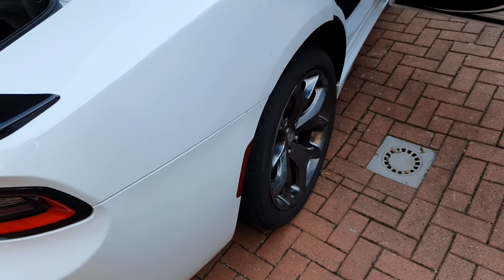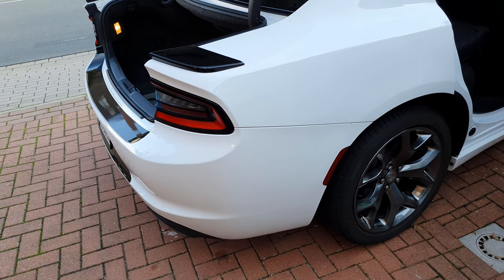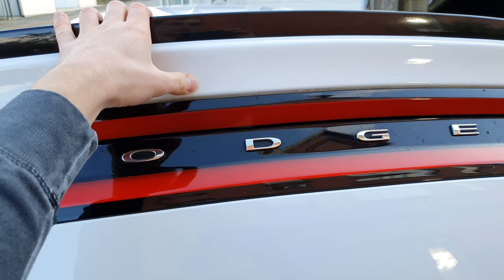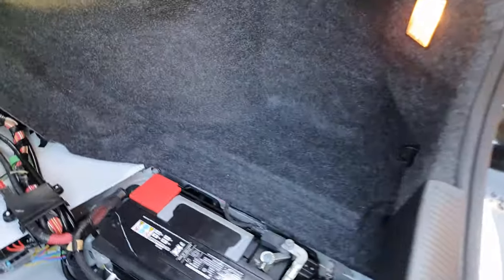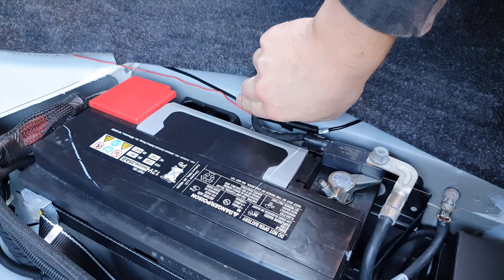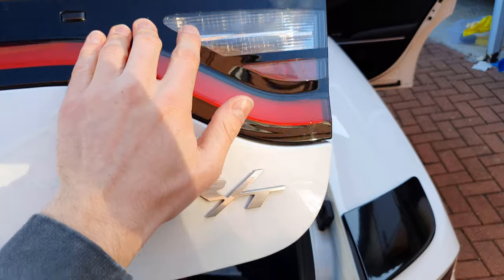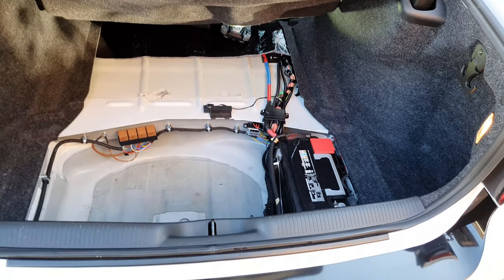When you do that — which is underneath here — you need to be careful and watch out that everything looks fine. I was clearly not about to cut through any metal. I've seen pictures where people put their backup camera in this place and cut through the metal, and I'm really not a fan of doing that. The wires end up over here — this is the wire that goes to the front of the car and needs to be connected to the plus of the rear reverse light, so the camera automatically turns on when you shift into reverse.